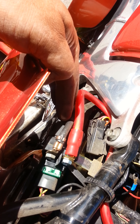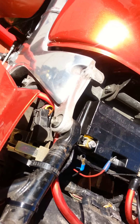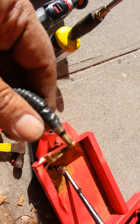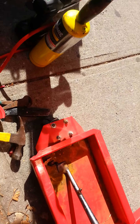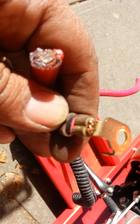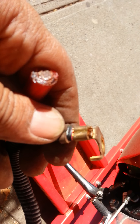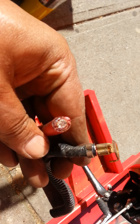That will be the first half of the positive line to the starter relay. You can see the second wire — I'm not using anything fancy. The upgraded line compared to the stock: this one is four gauge, and that one there is whatever the factory is — somebody said online it's like seven or eight gauge.